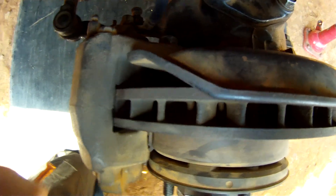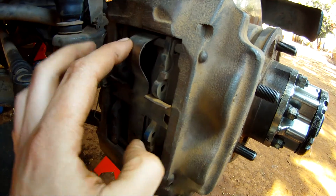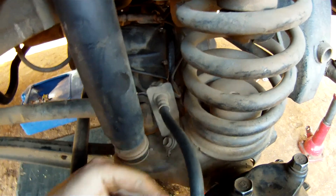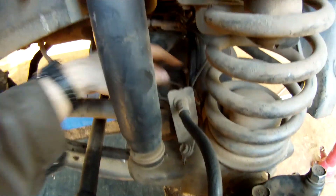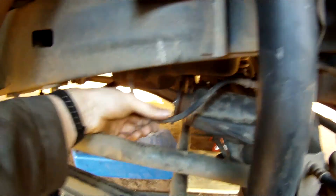So that's amazing really. The caliper's got a very similar arrangement — pads held in with pins and retaining clips. The brake hose is one single flexible pipe that comes straight from the caliper straight to the bracket, and then it's fed over the top of the differential with another flexible.